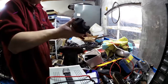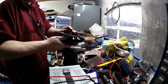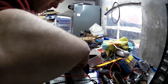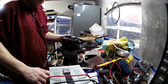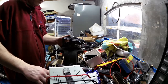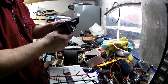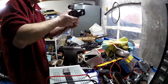Because when I put 12.5 volts on this baby, it's also... I hate it when that happens. Stuff not working. Off, you're off. At 5 volts, it's already drawing 2.5 amps. At 12.5 volts, it's pulling 3 amps. So somehow, oh wait a minute. The resistance inside is much bigger.